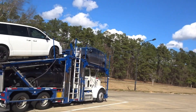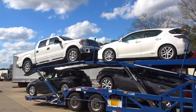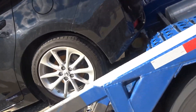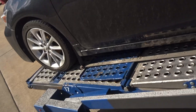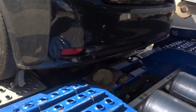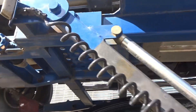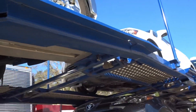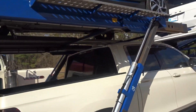When I lifted my height stick up to 13'6" it didn't touch any of the vehicles. For loading this car back here — it's front-wheel drive — what I normally do is leave the shotgun all the way out, put the front tires on the deck, and then use the shotgun to bring it into where I want. That way I know I have enough space and I'm not going to run my bumper into anything, and I have enough height clearance at the head rack. As you can tell there's tons of space, and I could have lifted it up even more if needed.